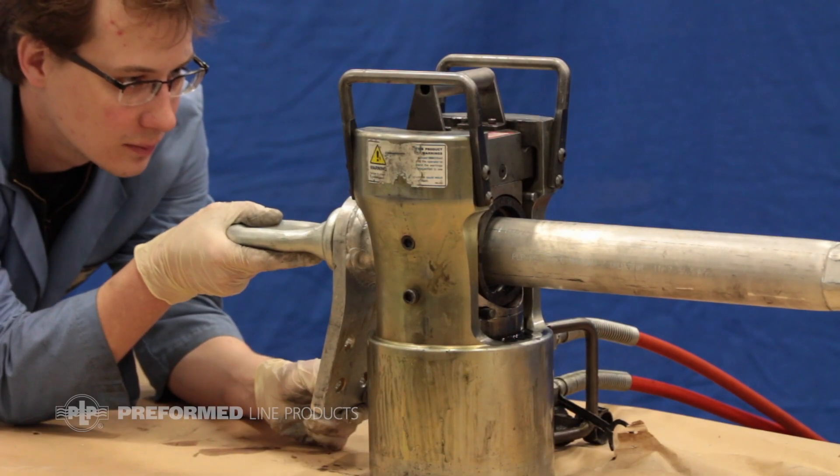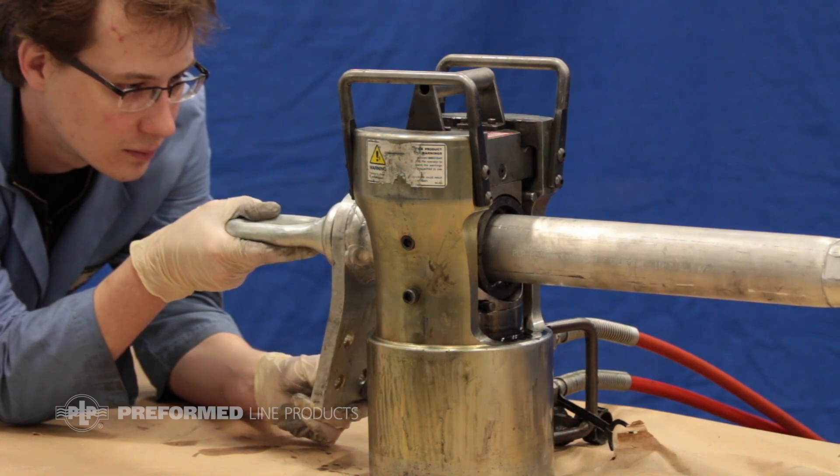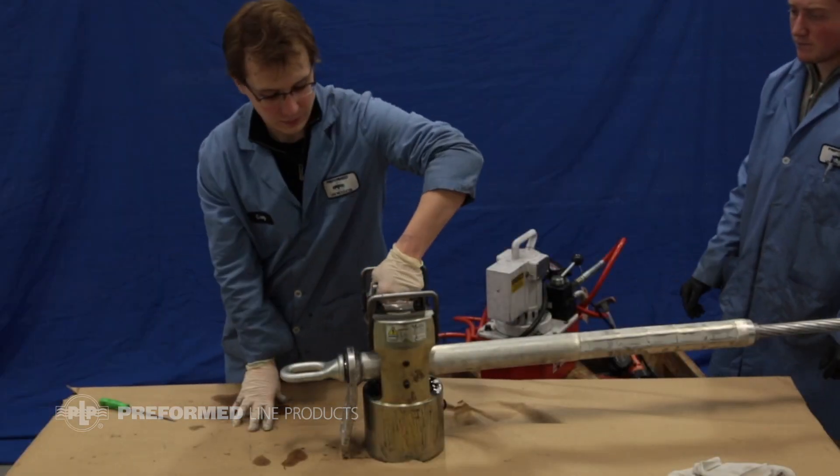Compress the area marked on the outer aluminum tube close to the eye, starting at the mark further from the eye. Compress until the o-ring is flush with the pad.